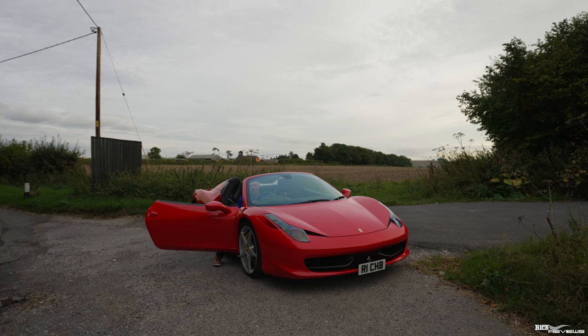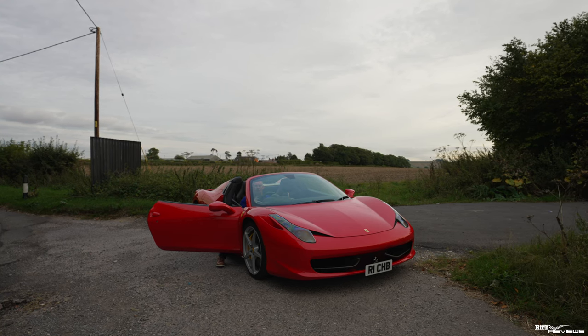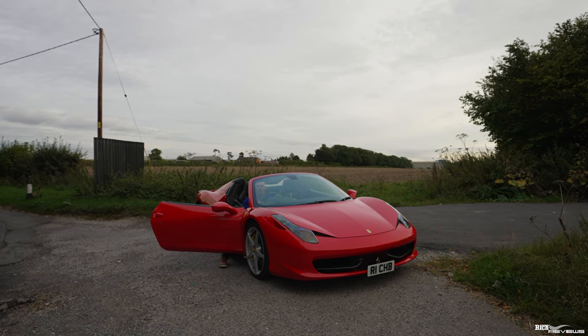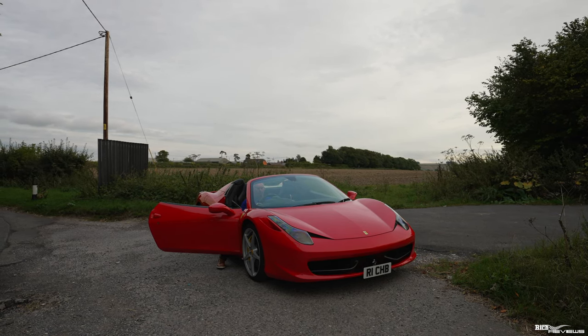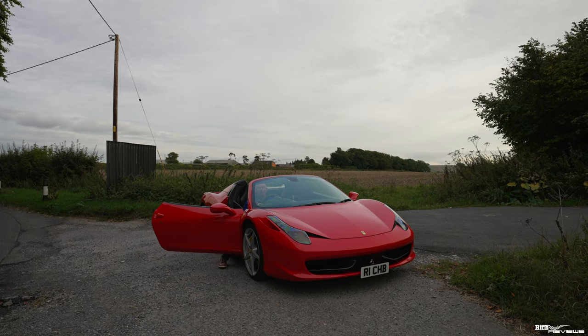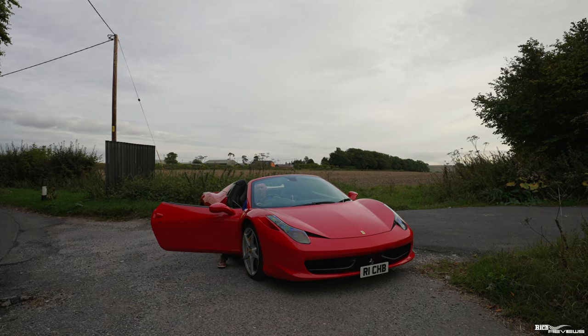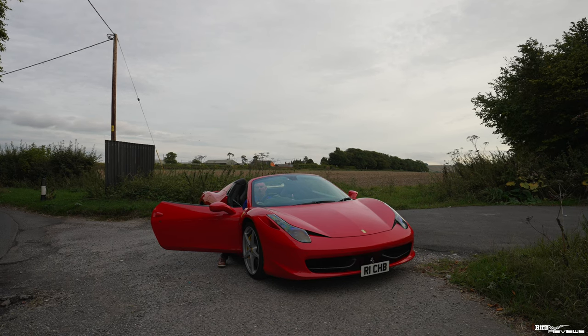We've covered off, guys. So now we're going to move on to some ancillary component checks that you need to perform, predominantly leading into tires, battery, and bits around the suspension. But let's talk about the tires first of all. Whichever tire you're checking out of the four, obviously you need to check all four, make sure that you can see the tire tread properly when you're checking the tread depth. We're also going to go through the tire pressures in a minute.